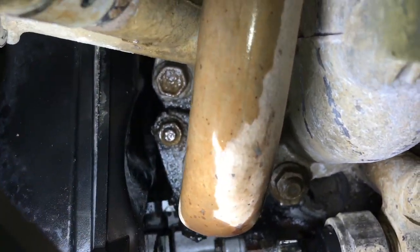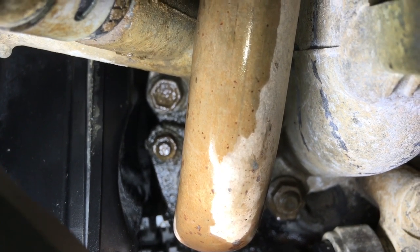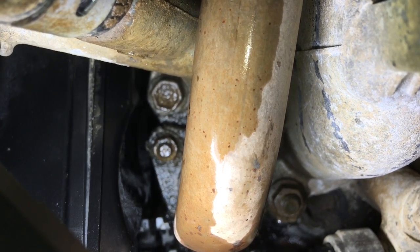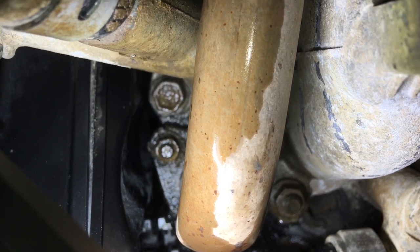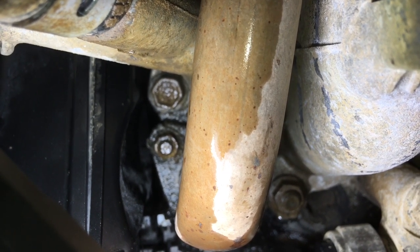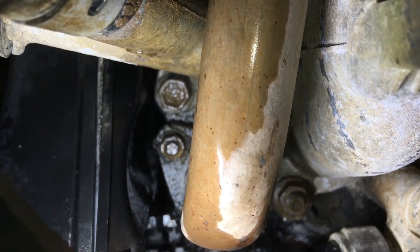You get the idea. The one underneath the top of the two is the top bolt. It did make a little crack like it was going to turn, but when they crack, they sort of turn a 12th of a turn and crack and then relock again, so nothing really cracked loose. So I won't even nip it up, that'll be fine. It's never going to come undone, it'll never leak. I think the best option is to not touch it, in the customer's best interest overall.